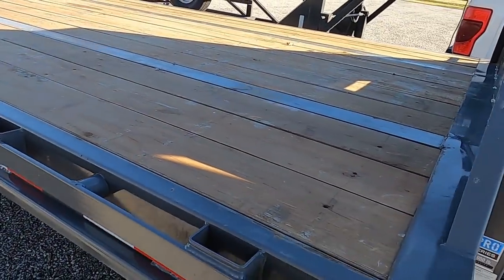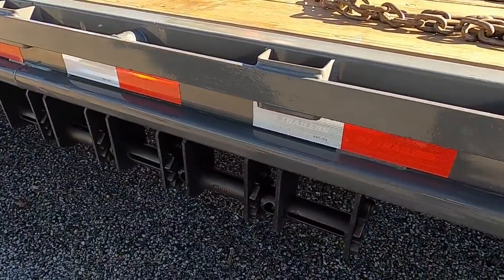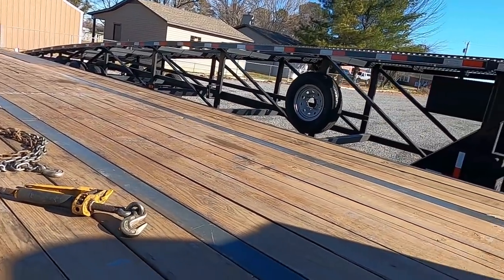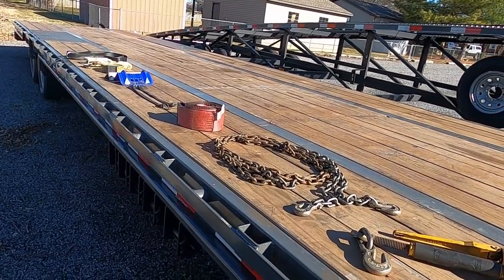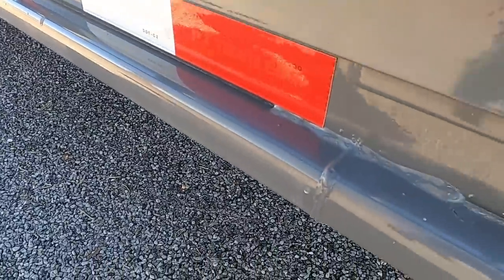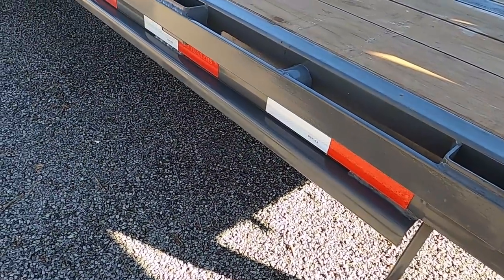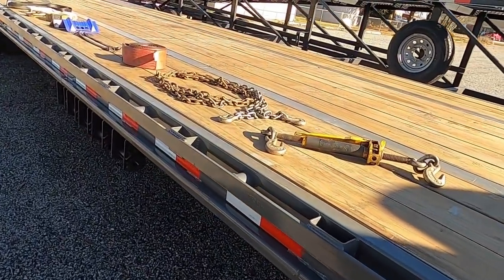One of the things I suggest when picking out a trailer is that you end up having a winch track on your trailer for a 4-inch winch. They're just so much better than using 2-inch straps all the time. A 4-inch strap has a wider footprint — you'll be able to tighten it a little bit easier, especially with edge protectors, before you start cutting into the load, which 2-inch straps tend to do when you tighten them to the point needed for securement. Four-inch ratchet straps are expensive — these come in typically 6-foot sections, usually about 50 bucks a section, and you'll need about five sections. If you already have a trailer, buy the winch track yourself, have somebody weld it on, and if you don't know a welder, this is a great time to get to know one.